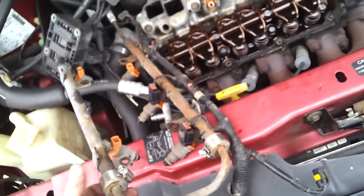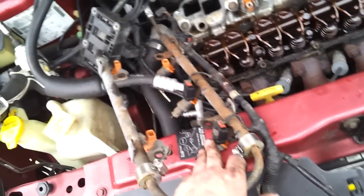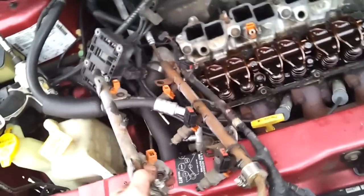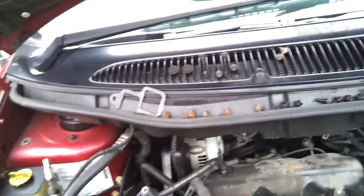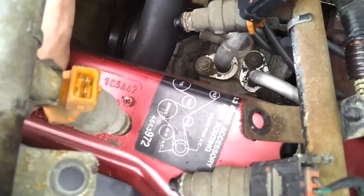Remember, there are gaskets inside the fuel rail and outside the fuel rail, so now would be a good time to check all your injectors. If you don't know how to check them, there are strictly fuel injection shops — I have a friend that specializes just in fuel injection. I'm going to do a partial rebuild on the fuel rail. I've got to have my friend check the pulse of the injectors. Also, if you had just used the car, you're going to want to purge the fuel pressure out — you can do this with a flathead screwdriver or a purging device. Wear some safety goggles. Now is the time to change everything you could possibly think of.